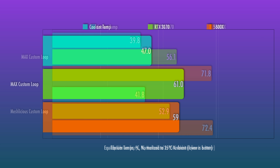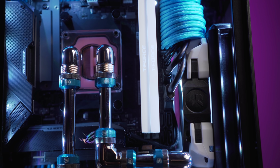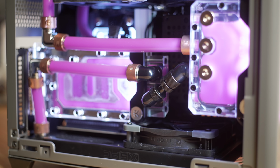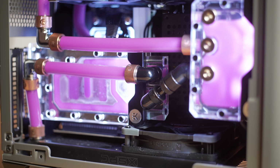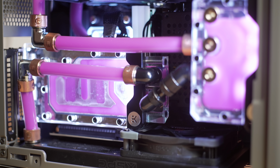The T30s do work very well at lower RPM, so in real world use for something like gaming, what you'll get here is a dead quiet system with very good performance, and for a silent system at sub 900 RPM, these are very decent thermals. Visually, I think you can make an argument for either. The way you display the NR200 is a little bit more limiting if you want to see inside, but the view from here is just so spectacular. There are these cascading layers of intrigue, and it kind of leads the eye into the build from here in, and it makes for a very stunning build also.